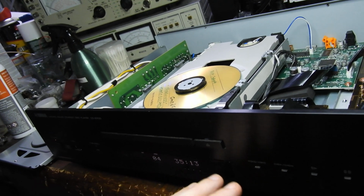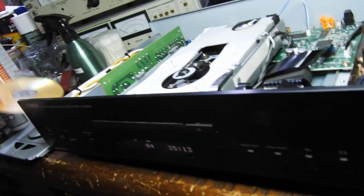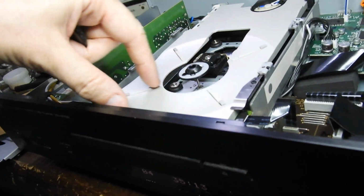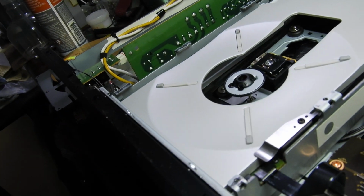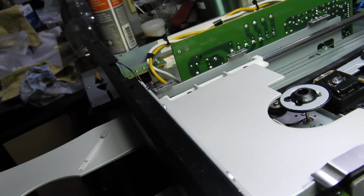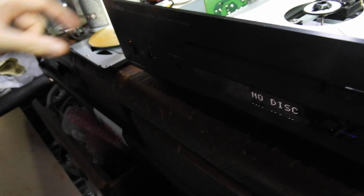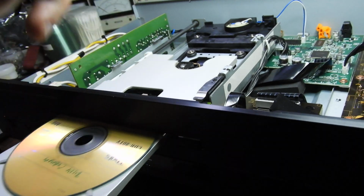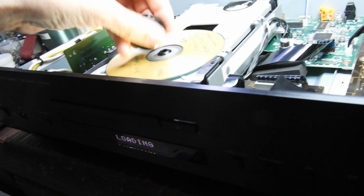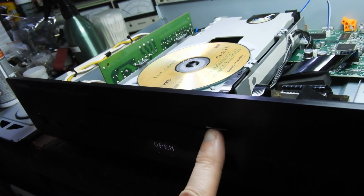So what was the fault? The fault was that just about there is a board with 6 limit switches, and when I remove the tray, you can see 1, 2, 3. It's very hard to see, but just glimpses of them. One of them got dirty, and that was it. Just cleaning of it with electronic cleaning solvent is all that was necessary. So too late. See, it was too late with that puck.